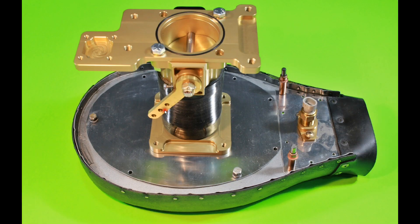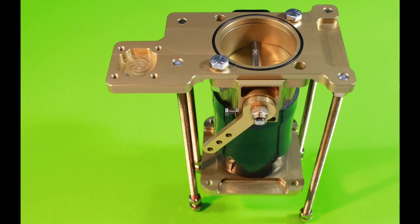This photo shows the assembly together. We've got the plate — this goes against the sump — the throttle body here, hose here, adapter here, and the airbox down here. These studs support the airbox and can be trimmed to length. The double nuts tightened up against the airbox support it.